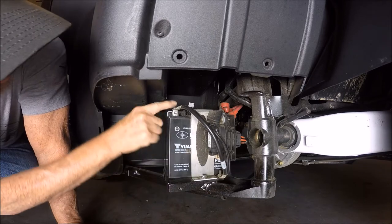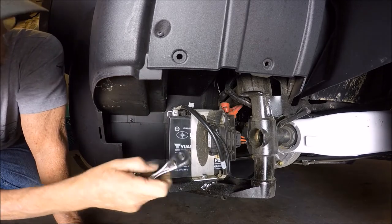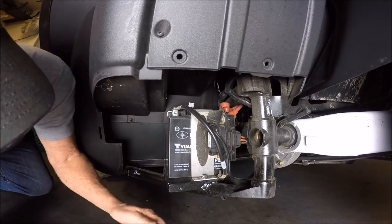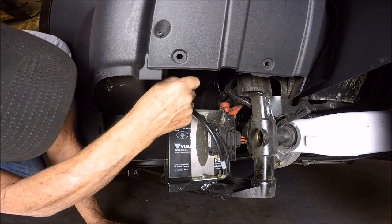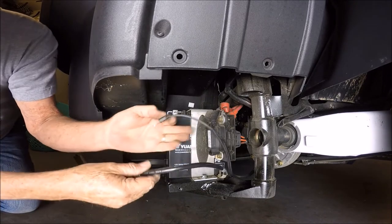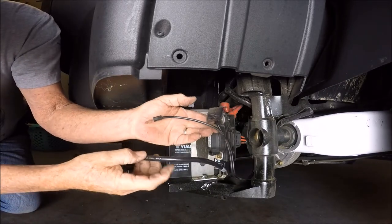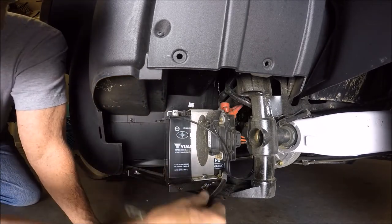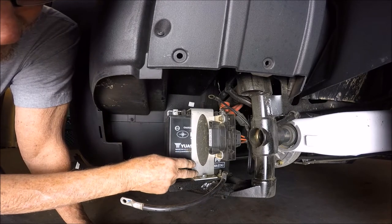You want to be cautious, so the first thing we're going to do is make it a lot safer by removing the ground first. With a 10 millimeter socket or tool that will fit in there — this quarter inch drive socket seems to work pretty good — you have one wire here going to the battery tender on the positive side, so those will need to be reconnected later. But now we're a lot safer. Now we're going to start taking the battery strap out.